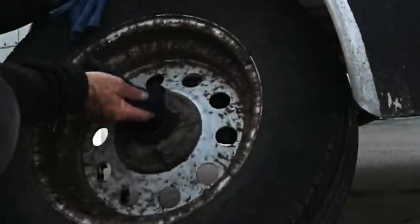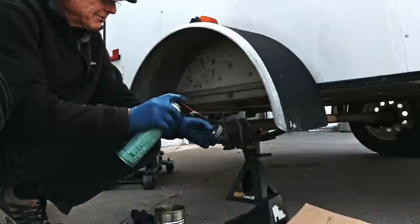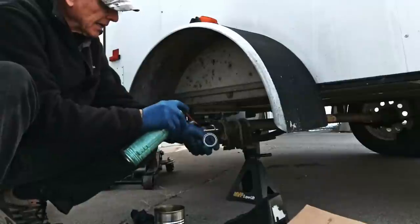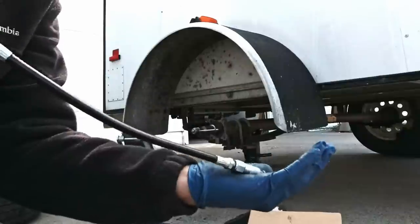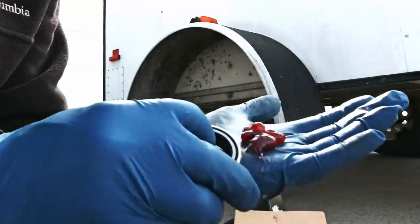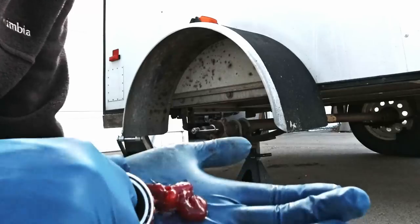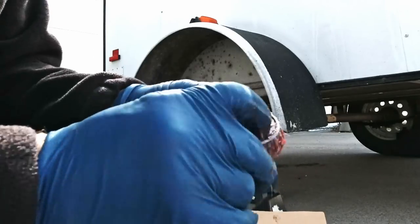I'll make sure everything is spotlessly clean inside here — both sides. These are looking pretty clean. I'm just going to rinse them off with a little brake cleaner — this also helps them dry really fast. Now this one's ready to be repacked. Now comes the fun part. You put a big dollop of grease in the palm of your hand, hopefully you're wearing a glove like I am. Then you work the grease through the bearing, going all around the bearing. See it coming through? Just working it through from the back side until it comes out the front side.